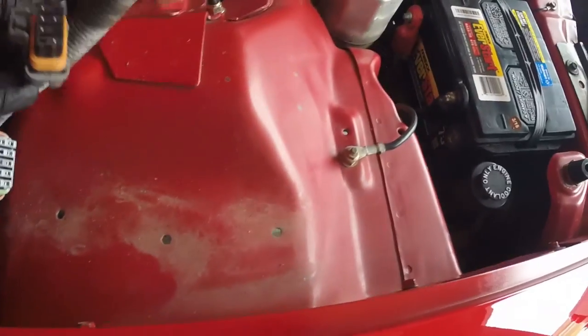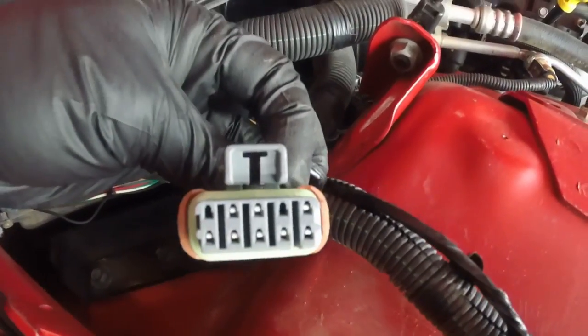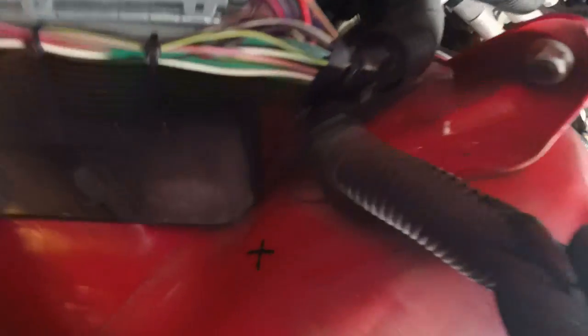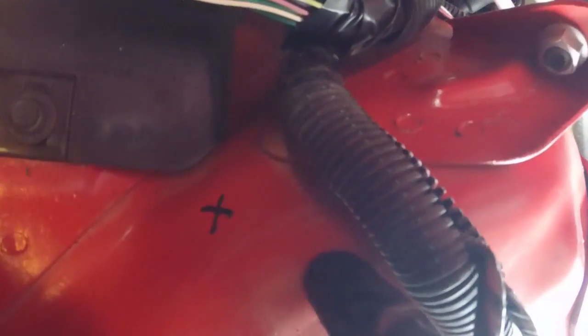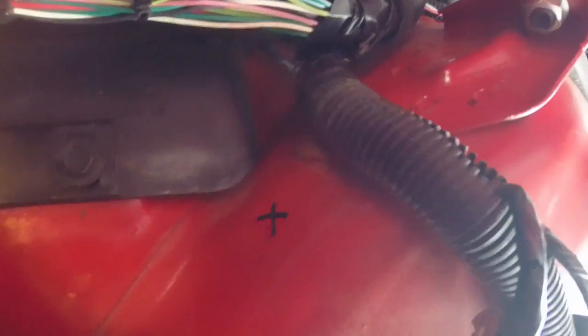Now that I've got all those plugs unplugged and separated from the inner fender, I went ahead and pulled the vacuum line loose and the wheel speed sensor out. I pushed everything through an opening right here on the side, so it's all down here ready to run on the inside. Our next step is to drill a hole — right here in front of where the computer tray bolts down. I went ahead and marked mine with an X. You're gonna have to make a pretty substantial size hole. I'm gonna make two holes beside each other with a step drill bit. You want to be able to not see as much as possible — you could pull the computer tray out and drill underneath it, but to me this is the easiest way to make it look nice.